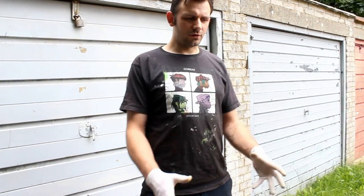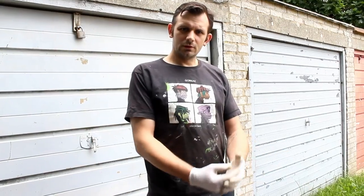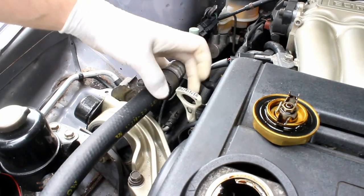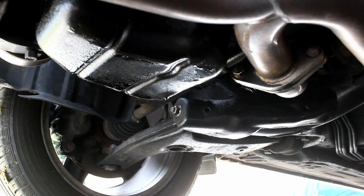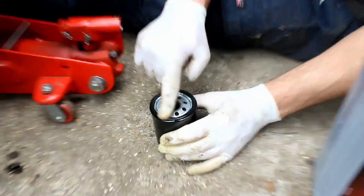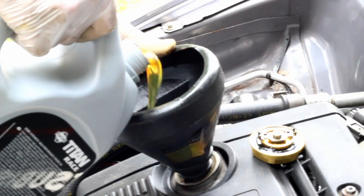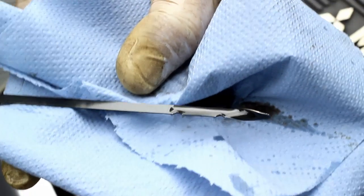It's a dead simple process guys. All you've got to do is make sure you've got the right quantity of oil, you get an oil filter, you jack your car up, you take your oil cap off, you take your dipstick out a little bit, you undo your sump plug, you let the oil drain out, and then you basically put it all back together again. Once the oil is all drained out of the car, you put the oil filter back on, you put your sump bolt back in with a new sump washer — that's quite important so it doesn't leak — and you fill your oil up to the right level which you've got in your car's manual or your guidelines, and you use your dipstick to check your results.